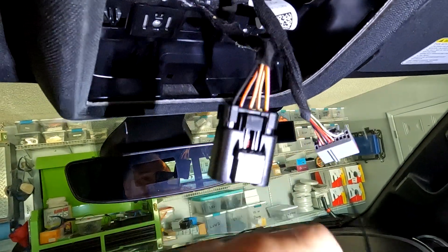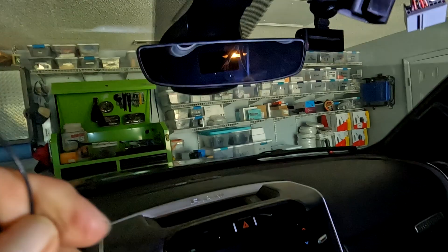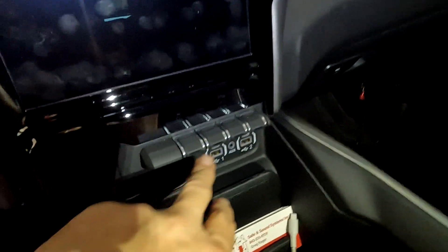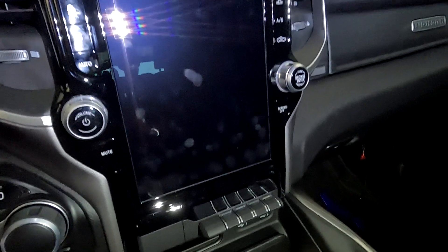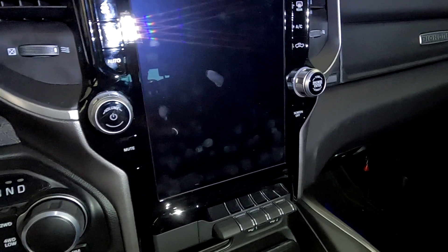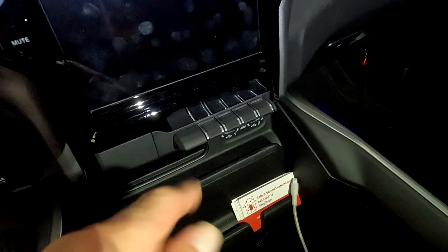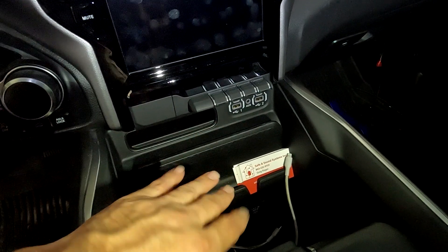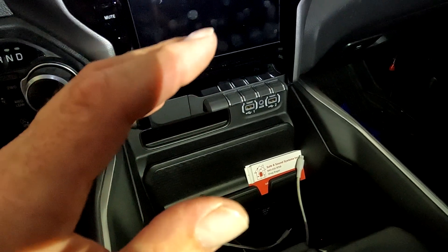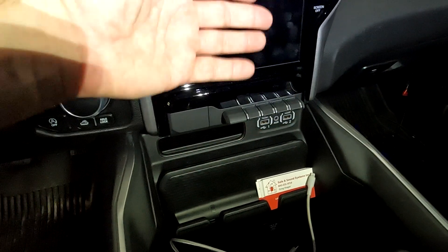I took the 15-pin lead — it's just a red and black wire that connects to the USB for charging only. The problem with RAMs and most Dodges is all these USBs down here are connected into the radio. So when you try to plug in your dash camera it automatically says 'this is not compatible' and it doesn't run the dash camera. I had a Nextbase that ran off the USB port below — USB-C to C did not work. This new camera will not run off either one; it just keeps saying 'device not compatible' and then the dash cam comes up and says 'no media card,' because it's trying to read it as an input and not as a power source.